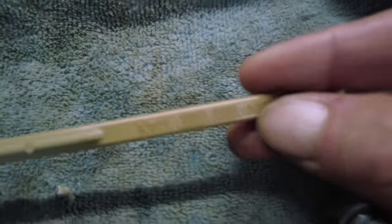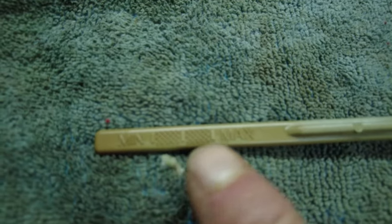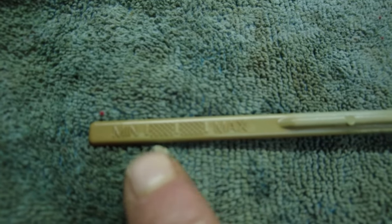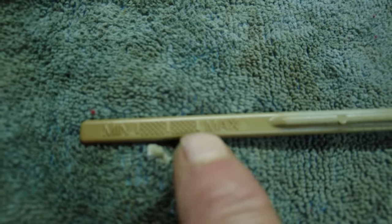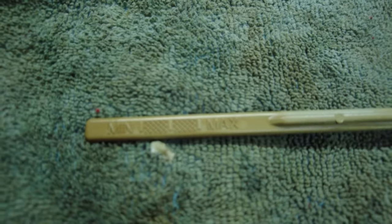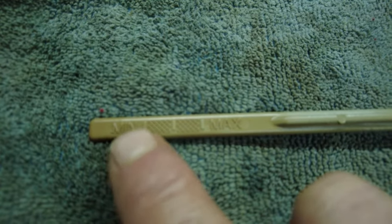And next we're going to talk about the engine oil dipstick when we're filling it later on. I'll talk about it now since I have it out and it's accessible. And I'll flip it around here. All right, so here on the oil dipstick, we have a min and a max. And you're going to see there's some cross hatching in the center, and there's three lines. As long as the oil is anywhere in this cross hatch, during operation of the vehicle in between oil changes, you're perfectly good to run. If it drops below the minimum level, that's when you should be adding oil.